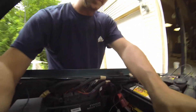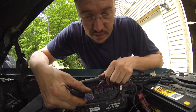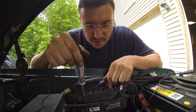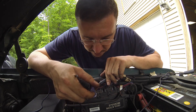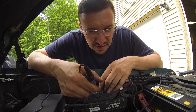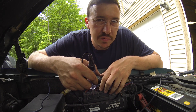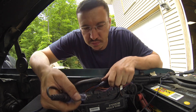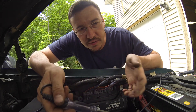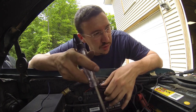That basically means the module is not sending power out — so it's either a bad module, or some other condition exists. Maybe it thinks the plow is connected on the left headlight side, and if it thinks the plow is connected it won't send power. The plow headlight didn't work either, so it could be a bad module. Replacing it is only four plugs and two screws — as long as I can exchange it.